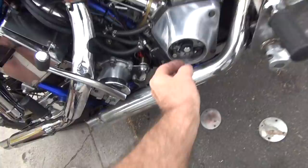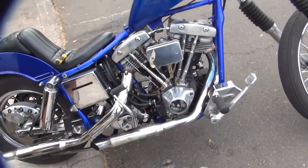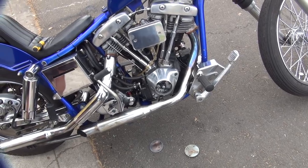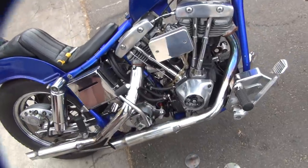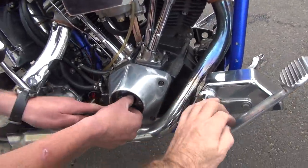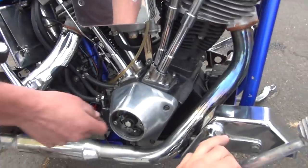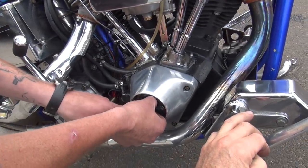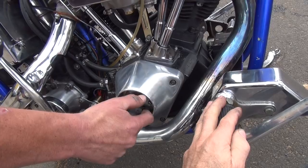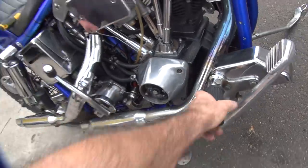Well, you checked it statically with it fully advanced, right? Yeah, and that's where I backed it off, and that's where it sparked the plugs. Seemed a little retarded. Not backing off, you fully advance and hold it. No, so I advanced it, and you're on the timing mark over there? Yeah, I was on the timing mark, and then I put it fully retarded and moved it until it sparked. That's not retarded, that's fully advanced. No, I mean I hold it fully advanced, put this plate back retarded, and move it forward slowly until it sparks the plugs. And that's happy there. Okay.